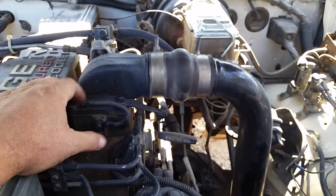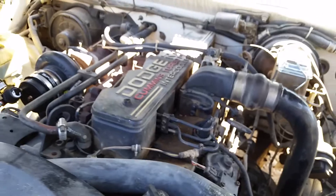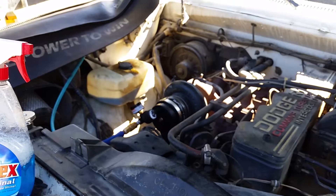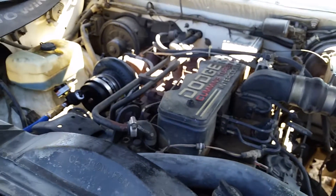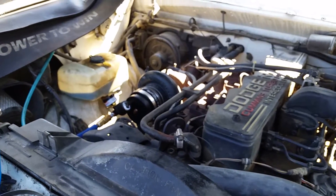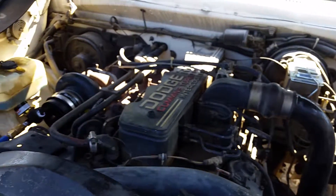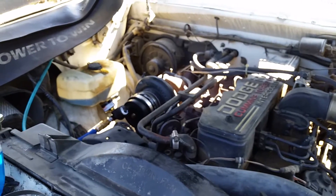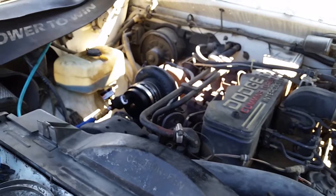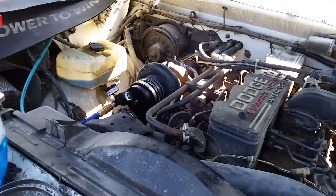I suppose I could test the intercooler now, but if it's bad — they're aluminum — I don't even know if you can buy one these days. Anyway, the test is complete. It took all day to get all the parts, and part of yesterday — living out here in the sticks, it's 90 miles round trip to Home Depot. It's a great test and it's worthy. 180,000 miles isn't a ton of miles, but this rubber goes through a lot of heat cycles, a lot of expansion and contraction. At altitude I'm losing horsepower, which means losing torque, which means losing gas mileage. I'll get this sealed up and see if it helps. At only 10 psi it already told me all I needed to know. Enough rambling — see you, bye.